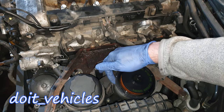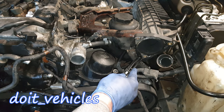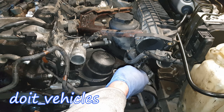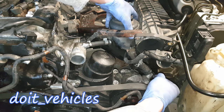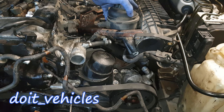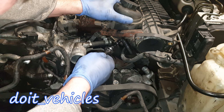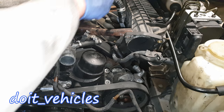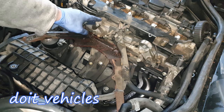First we need to release the power steering reservoir as well, because the leg is under the power steering reservoir leg. Let's disconnect the power steering reservoir — be prepared to drain some fluid. Use a pick or screwdriver to release it, and be prepared to catch the fluid. On the bottom of the reservoir you've got the return line, so release that hose clamp as well.